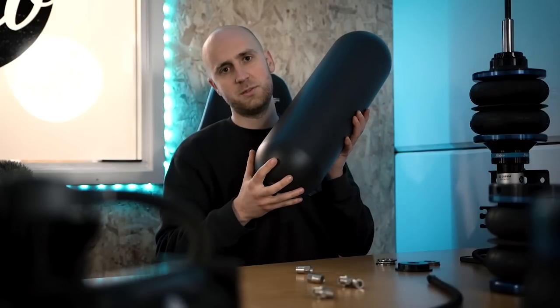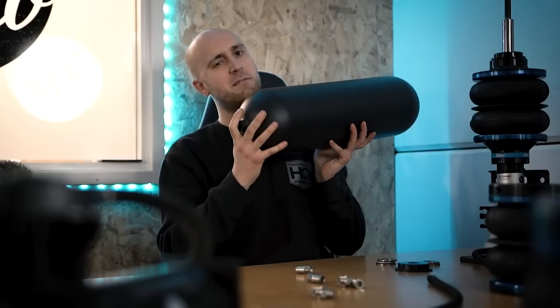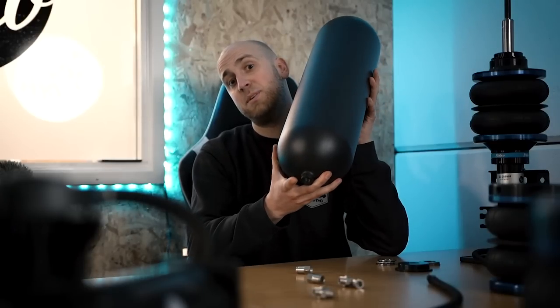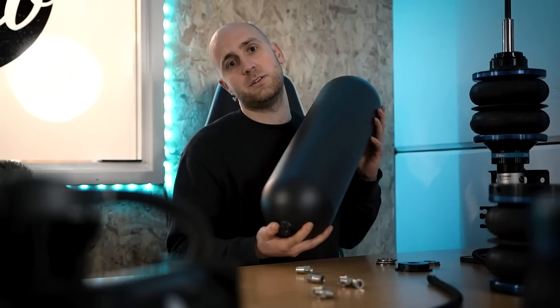Most seamless tanks have ports symmetrically on both sides, but we've put all three ports on one side. The exhaust runs down one side of the Transporter, so we want to keep the ports — and therefore all the hoses — as far away from the exhaust as possible. The tank is aluminium, which prevents the moisture-driven internal corrosion you get with steel tanks, preventing rust debris from blocking solenoids. It has a black textured powder coat finish so it looks like it belongs there and doesn't stand out.